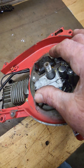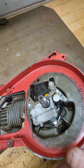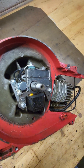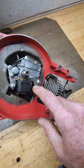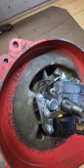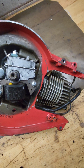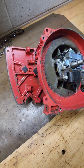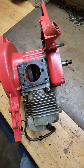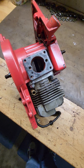I had some ignition problems. Per the service manual, there are three bolts that hold this on, and there's just a little bit of wiggle room. When you're putting it on, you're supposed to push this all the way to the left — maybe only an eighth of an inch — but I had problems: it was out of time and it was dragging a little bit on the inside of the flywheel. It does make a difference. I've got a good condenser, points that look good and clean. It's about as clean an old saw as you can get. Once I get it all torn down I'll start scrubbing, cleaning, priming and painting. It'll probably take a while, likely won't get it done until the weather warms up.